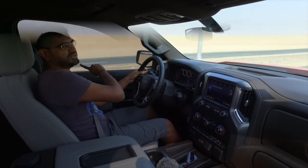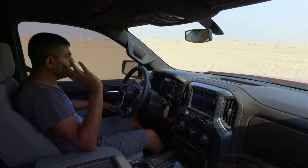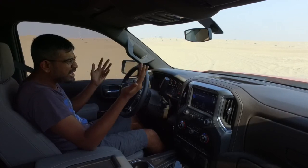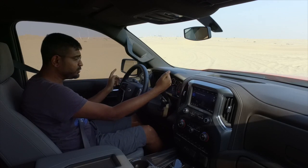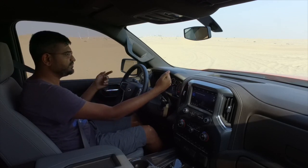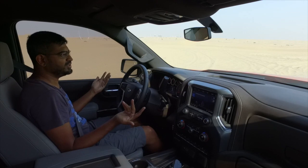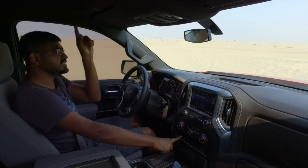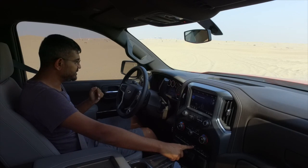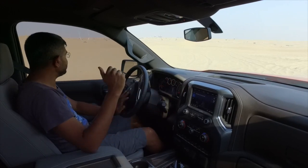Let's get off-road. I'm going to make this brief because it's July in the Middle East, nearly 40 degrees. I've deflated the 18-inch wheels down to about 15 PSI per side — as much as I want to go to avoid popping a bead off the rim. There are several four-wheel drive options: automatic for wet weather roads, two-wheel drive for fuel economy, and four-wheel drive. Before setting off, I need to disable the roll-sensing airbags and hold down traction control, which turns off ESP as well.